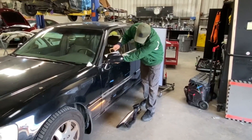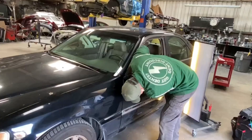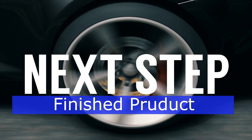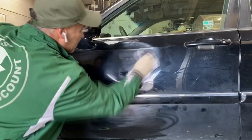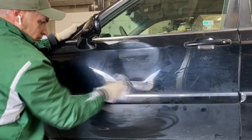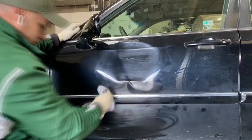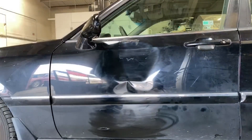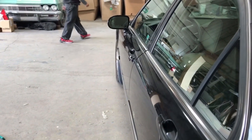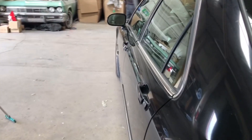The blue grease pin is representing the bracing on the back side — the tool is fitting nicely behind the brace. Standing upright to remove the horizontal dents, working upside down to work the vertical dents. Here is the before the bridge work and the after — you can see the PDR bridge works great for bringing up big deep dents. This door is a repaint so it doesn't have to be perfect; I just need to get it flat.